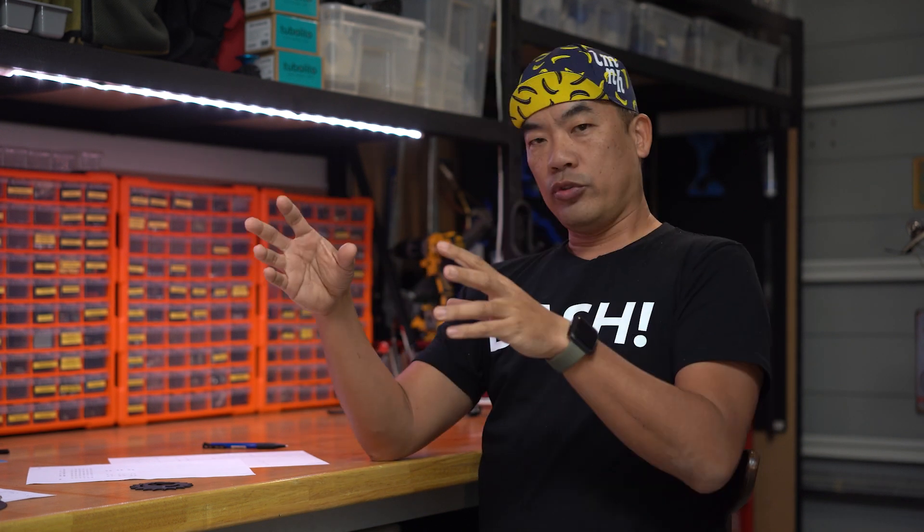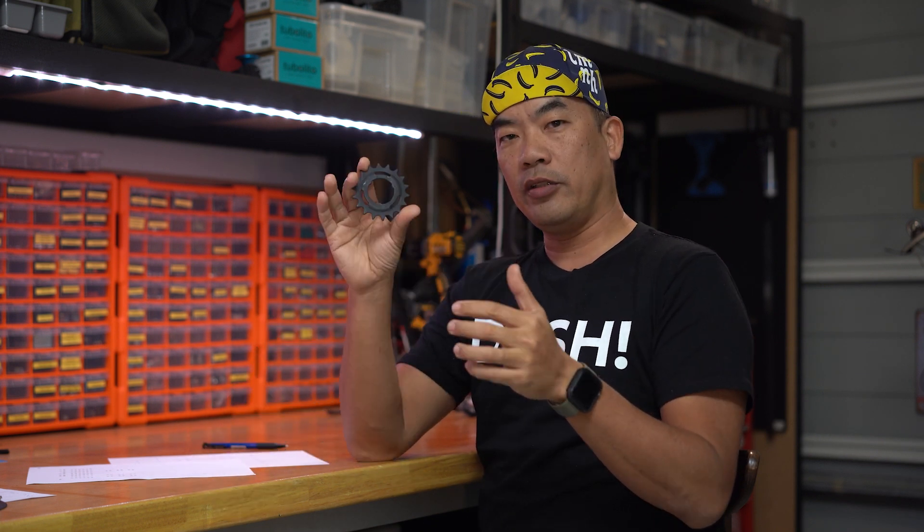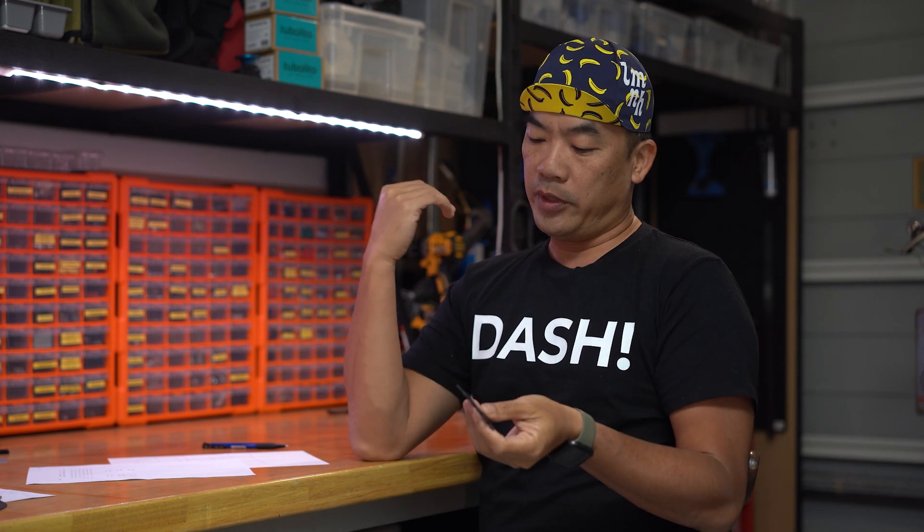My life is going to be so much better! Are you guys having difficulties with your gearing? Is it too hard or too easy for you to pedal? You might just need to find out what you really need. If you're having issues, state it down in the comments — I can explain more on how to modify your chainring or rear sprocket to make your ride feel much easier for your own fitness. For now, I'm going to install my 18T sprocket to my rear wheel and tomorrow I'll be heading out for a ride.